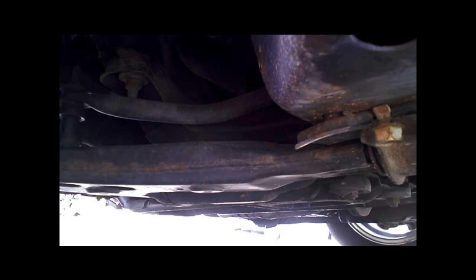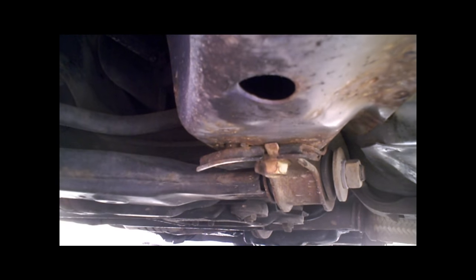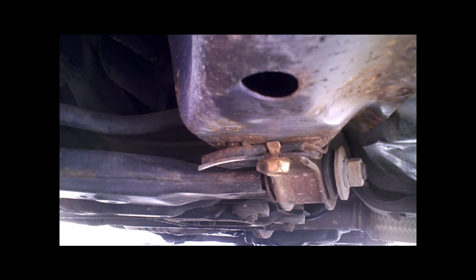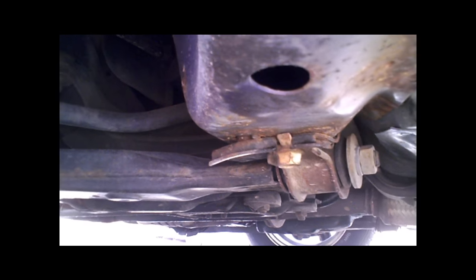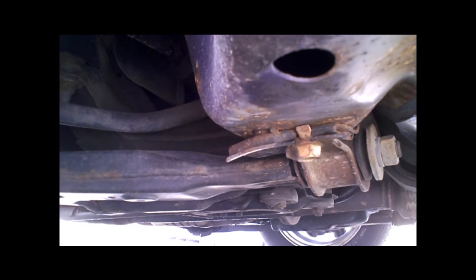So what I'm going to do is first disable the airbags, then tie a chain to the A-frame and back up a couple times, give it some good jerks, get it back into alignment, straighten it out, see what we can do. A little redneck backyard mechanic frame straightening.